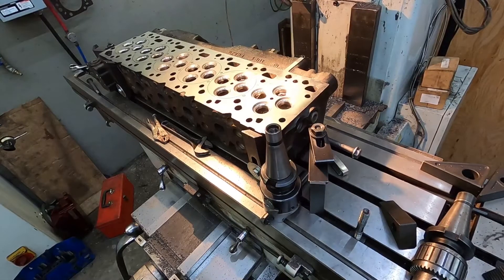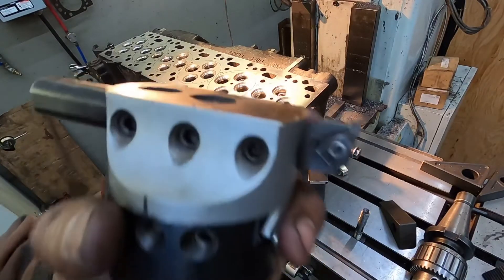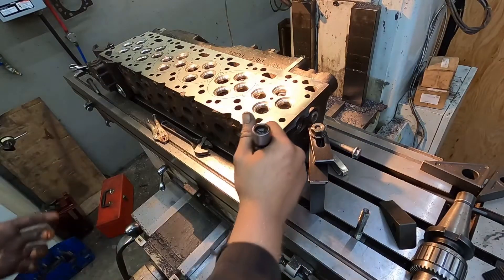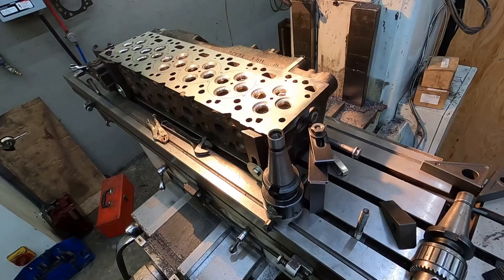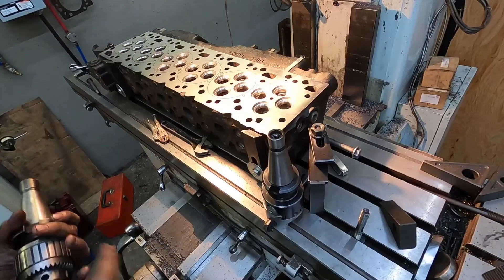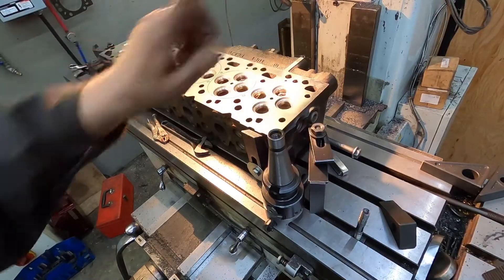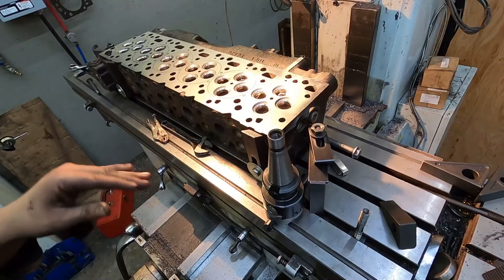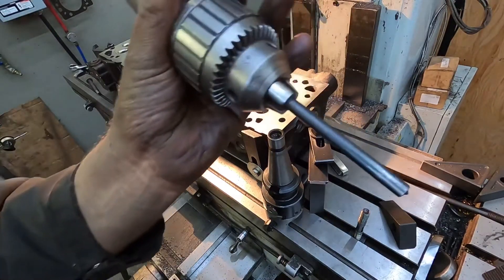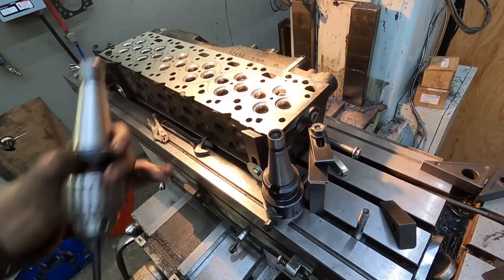For the guys that have never watched me do this — this is the cutter we use, which is actually an inside cutter for cutting inside grooves. It's a 39-thou cutter and we insert a 41-thou ring. On a 24-valve Cummins head, the injector is centered to the bore, so it's easy to line them up. All I use is basically a piece of rod in my drill chuck and put it in there.